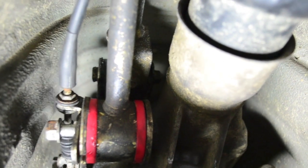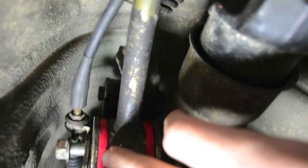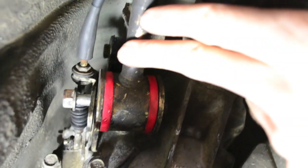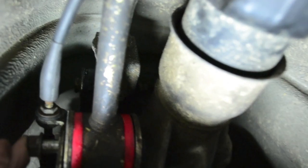As you can see, I've already done both my bushings, so there's no need for me to take out the whole linkage. But once you pull this down, just take a screwdriver and that'll pop right out. Then just insert the new ones with the lube. When you go to reinstall this, put the bolt a little bit in, push the linkage back up, and push it in as much as you can.